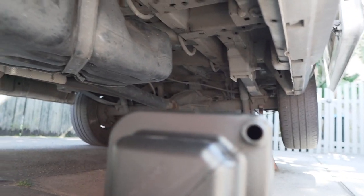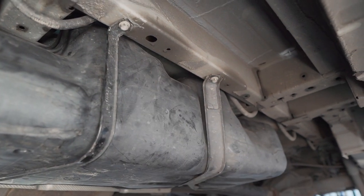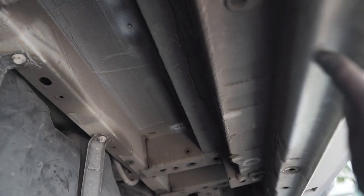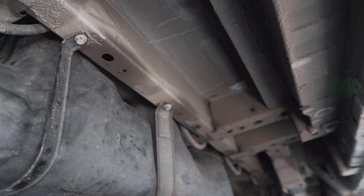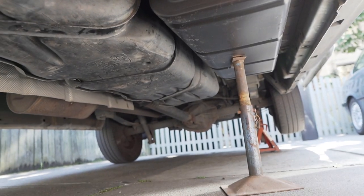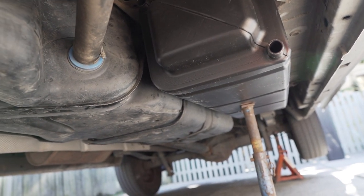This is my greywater tank and it's going to sit right next to the fuel tank on the passenger side — it fits really nice and snug. I'm going to make brackets similar to the fuel tank brackets, attaching to those fuel tank nuts on one side and to the chassis on the other, with three U-straps screwed in with tech screws. The freshwater bracket needs to be more heavy-duty since that tank is much heavier.